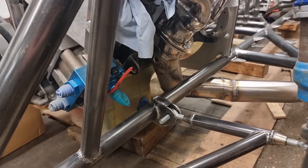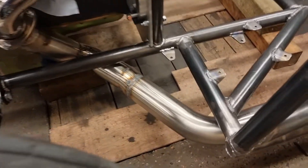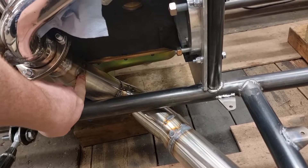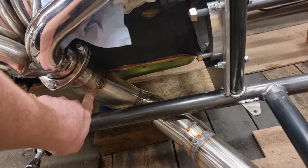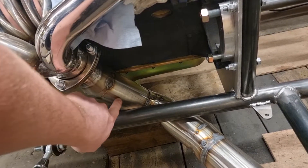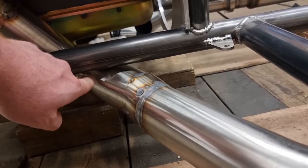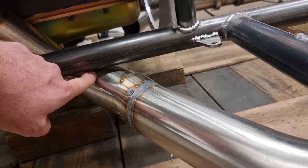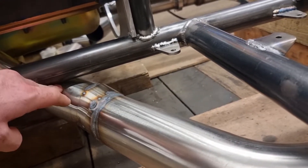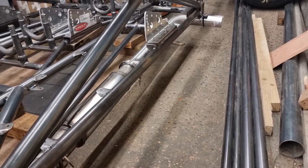As you can see it's got a few little tiny seams on it, nothing massive apart from this one down here. It's a two and a half into a three inch, tiny little 15 degree pie cut to kick it out. Straight three inch tube down, pie cut it around. That's got about two mils of clearance between that chassis rail there. We'll put some padding under there to stop it if it bounces up. It's nice and tight there to the rail, and obviously it comes back down to the already built exhaust from the other day.